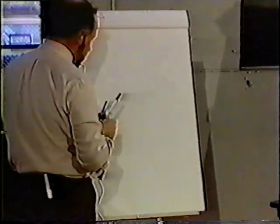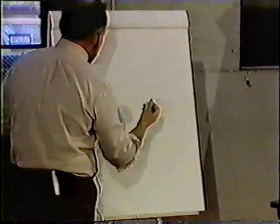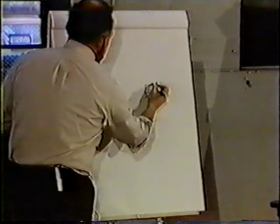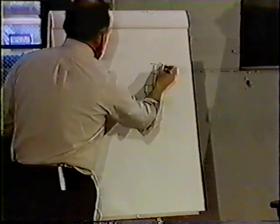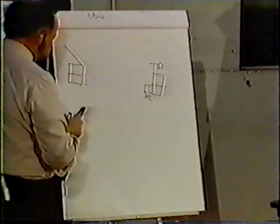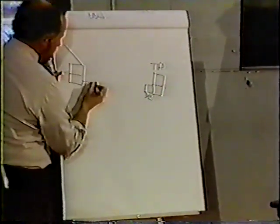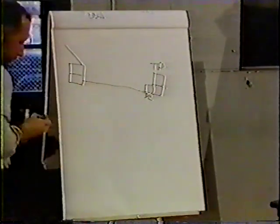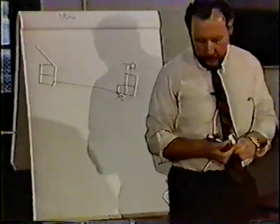Both primary and secondary air go down to the double check valve located here, prior to the tractor protection valve. So our secondary air, that was our front axle air, that pressure is delivered to this double check. Now we've also got our rear axle air, which is going back there.